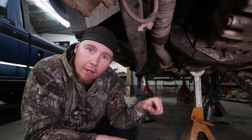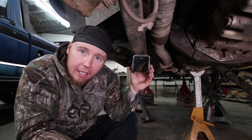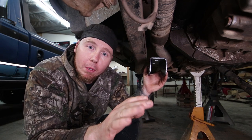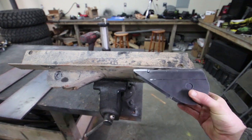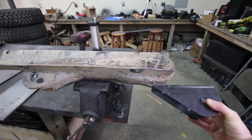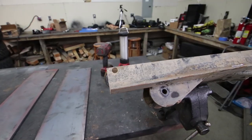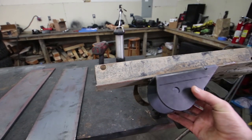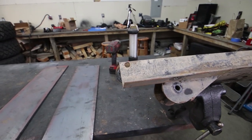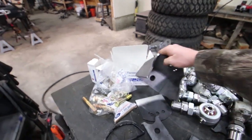There are a number of issues with mounting it directly to the frame rail. If we mount it there, when you turn all the way one way or the other, the back of your tire is going to go right into the link. If we can move these in just a little bit, it gives us more triangulation and a little more room for the turning radius. In this new setup we're running a three-link in the front, mounting it to the bottom of a plate I'm going to build that anchors into the frame rails. The rear will be a four-link with the same approach.